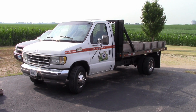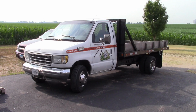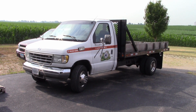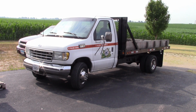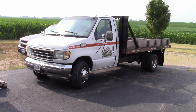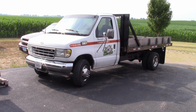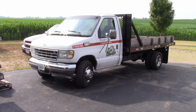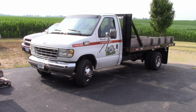And it's back. This poor guy's gonna wear this truck out, just bringing it over to my shop. The owner tells me that it still has some kind of a transmission problem. I didn't have any issues when I drove it, but he said if you make a short trip, let it idle, then make another short trip, that you have problems shifting. It shifts late, shifts hard, drops into neutral. So there's something that we're still missing.